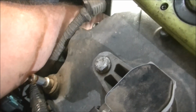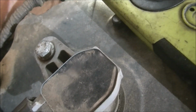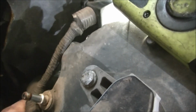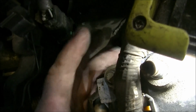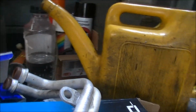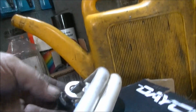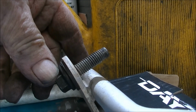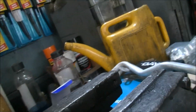And so, yep, I think I've undone the pipes. Well, that's going to be one. Is that the other one? No, I think that's it there. Okay, so what have we got here? There's a little bracket down here. Feels like that might be a 15 mil. So you can see that nut just here, I think. Undo him, and these pipes should pull out. So there's the heater pipes out of the way. Got me beat why they think you need that bolt to hold that. Look at it. That's all it holds. Anyway, way too long for the purpose.